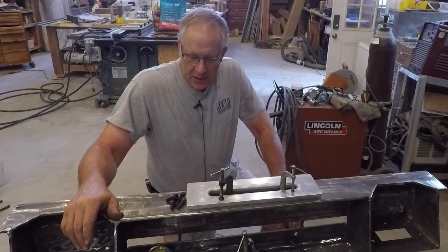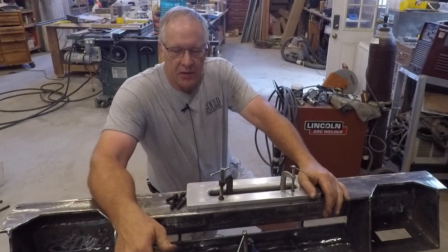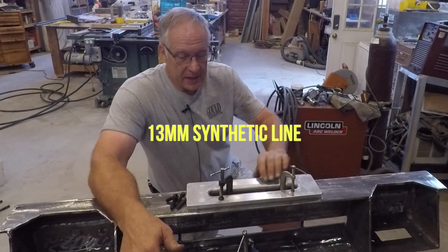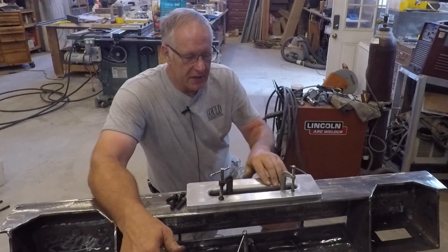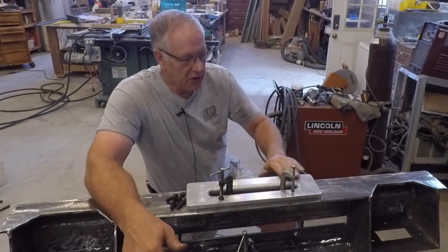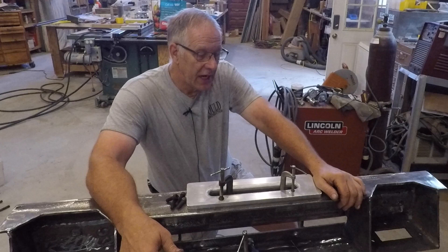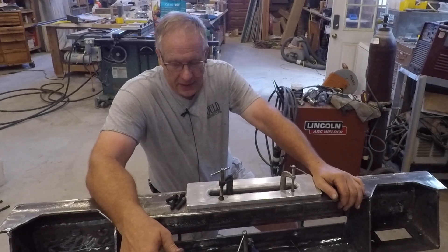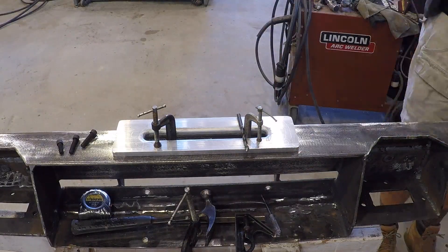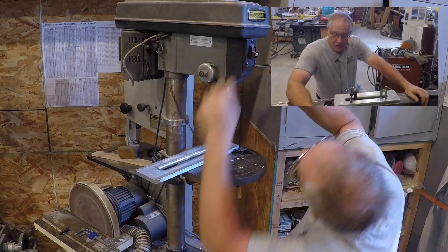I'm getting down to the end of the winch mount. One of the last things I'm working on is this plate. Because this is a very large winch, I'm using a large half-inch diameter — actually a 13-millimeter — synthetic line. The guide for the synthetic line should be aluminum, because the high pressure of an off-angle pull will cause the line to rub substantially on the hawse, which is what this is called. With synthetic line you can use an aluminum plate rather than rollers — rollers are required for steel cable because steel cable will cut slots in the aluminum. I've had to make my own aluminum plate because this winch is wider than your standard winch.